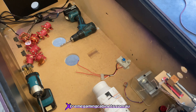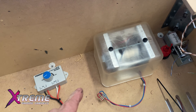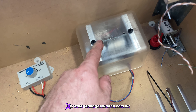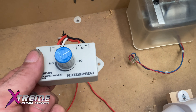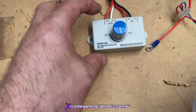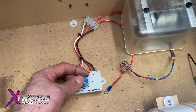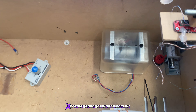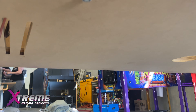Sorry guys, just a quick one before we show it all finished. I've just installed the shaker motor - it's a genuine Stern shaker motor with the large weights. Unlike the one that was in here before, this is the real deal. If it were to come loose it would completely destroy the inside, hence why it has a cover on it. There's now also a switch - the previous one was just one fixed volume. Full volume is way too high; about half is really good. But if you want it a little less, you can adjust the shake to your taste. Let me quickly show you how important it is that it's properly bolted - it really shakes; have a look at that.